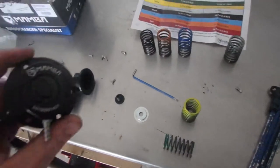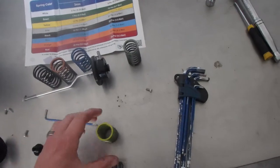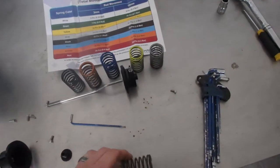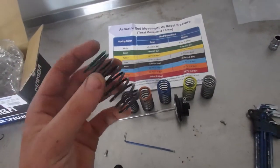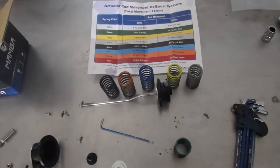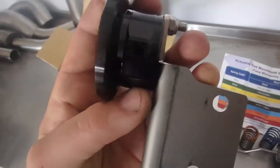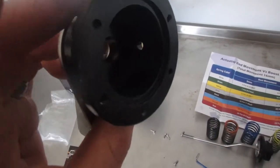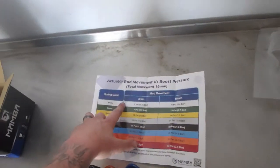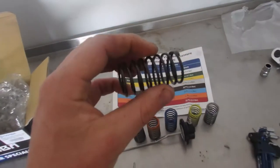We're back. I've disassembled the gate and by the looks of it I have the 12 PSI spring in there, which is definitely not what I want as I've only got a factory ECU. I just want to run around at seven pound until I can eventually save up and get a tune and a bigger turbo. Now I didn't realise there's a hole here where I can actually see what type of spring I've got. I thought I had the white one — turns out I had the yellow. So I'll fit the green one, put it back together and we'll chuck it in the Skyline.